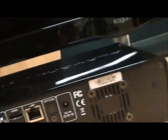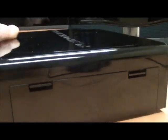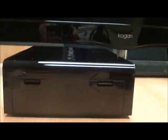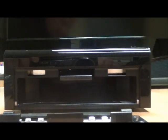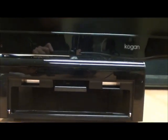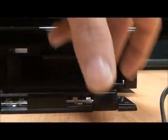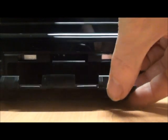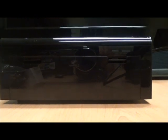Obviously where you plug in your power pack. And there's a fan on the back because the hard drive inside will warm up a bit. Now on the side we've got a nice easy access hard drive port. All you have to do is pop these little toggles at the top and flick that slide door down. You just slide your hard drive in there — it's got guided plastic stubs on each side so the hard drive will just slot in nicely. It'll click in firmly at the back. The side door piece actually has a rubber pad in the middle, so once you sit the hinges in place onto their grooves and clip it shut, that rubber pad will push against the hard drive, ensuring a nice snug fit.